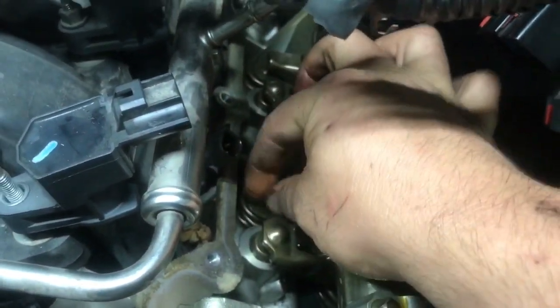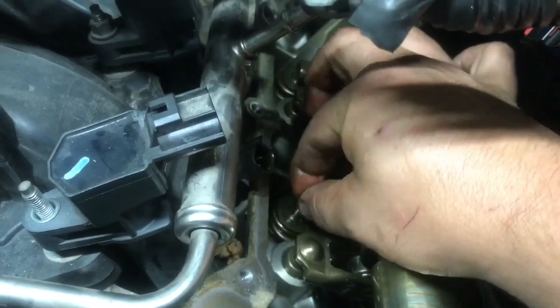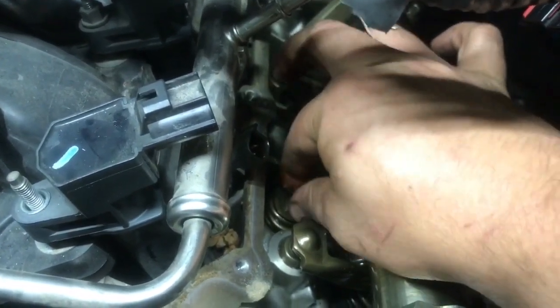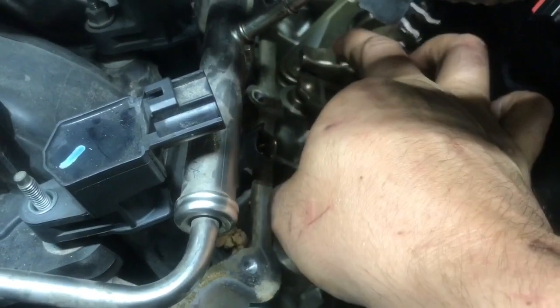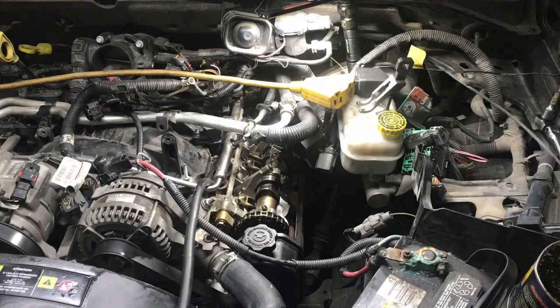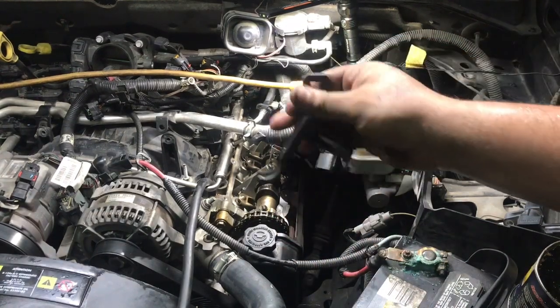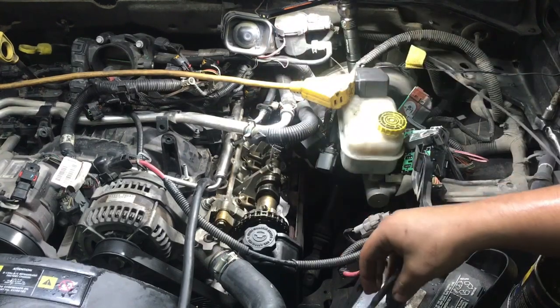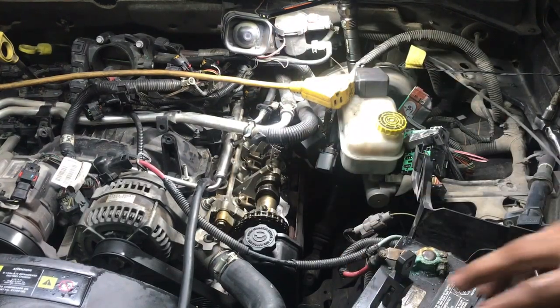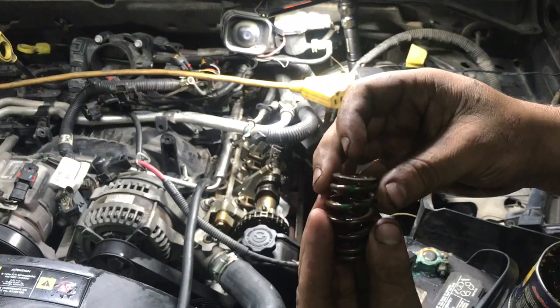Now what we're gonna do — I'm gonna take this off. I can literally turn this valve so easily. Check this out — I can move it up and down. I got a special tool for this. This special tool is what released the actual valve spring. When we pulled this valve spring off, like I said, it was completely broken into two. That's why we weren't getting compression on that cylinder.